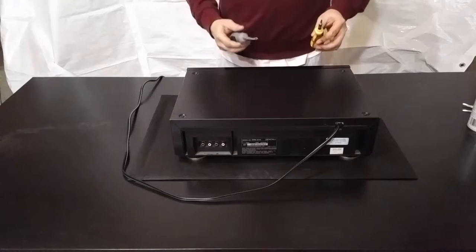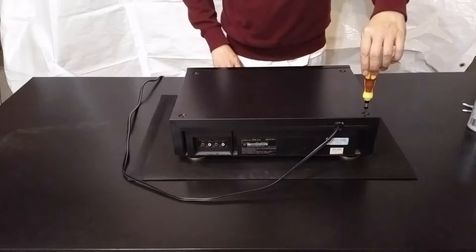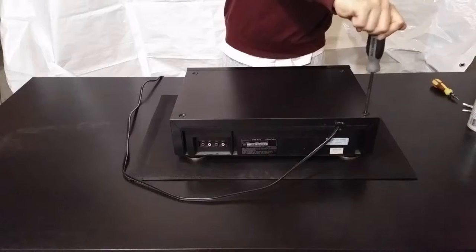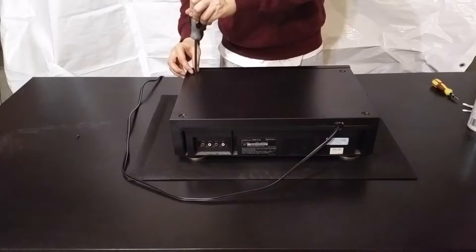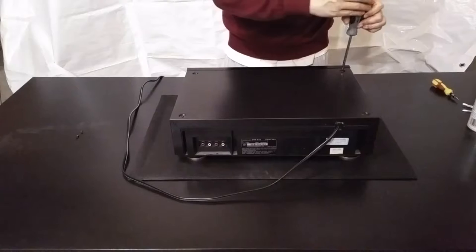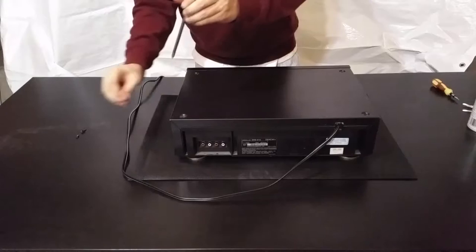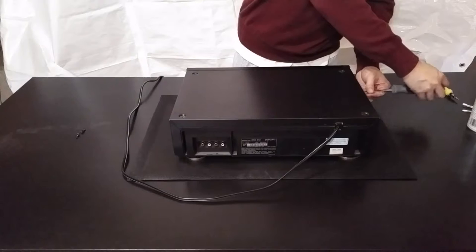As you can see here I'm going to show you my fat screwdriver and my precision screwdriver that I use for computers. When I place my precision screwdriver on the screws it feels a little loose, and that's definitely not good because you could strip the screws on your cassette deck. This is why I recommend that you get a fat screw head where the lock between your screw and your screwdriver head is tight and not loose. This will prevent your screws from being stripped. Another recommendation is that when you first try to turn, just do a short turn first to loosen the screws before you do a full turn, because the screw heads may be tight.